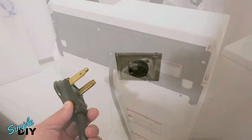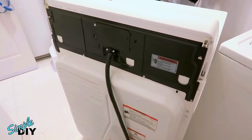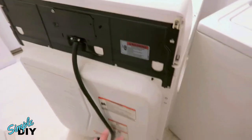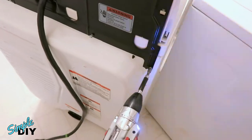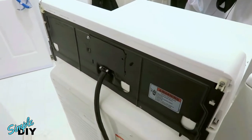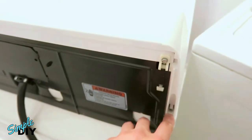Make sure you disconnect the power. Now you're looking at the back of the dryer. Depending on the make and model, this assembly procedure may differ between designs. On this Whirlpool dryer, I'll need to remove these quarter-inch screws. Once the bottom screws are removed you can lift it up. You'll need to remove the Phillips screw on both sides.